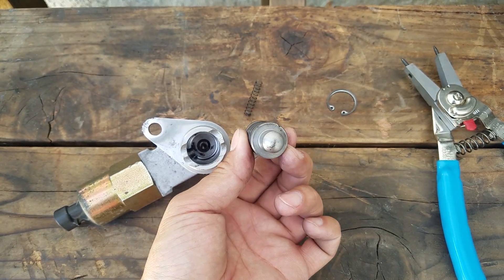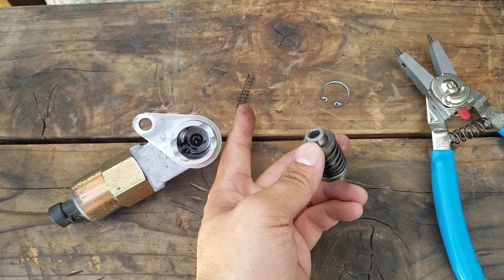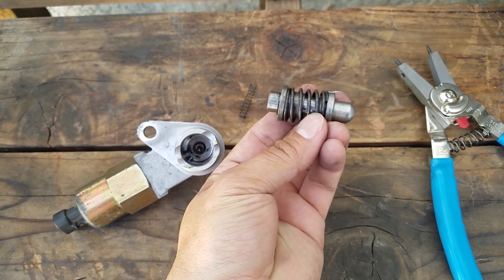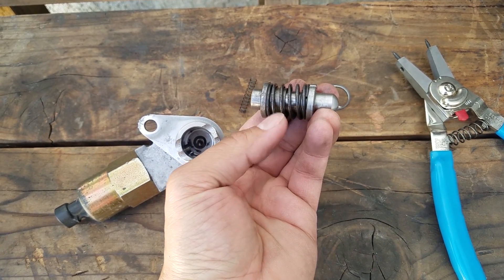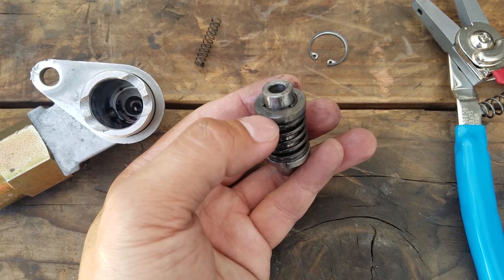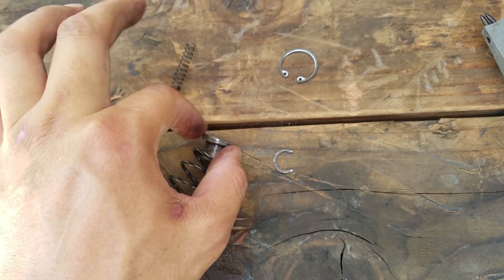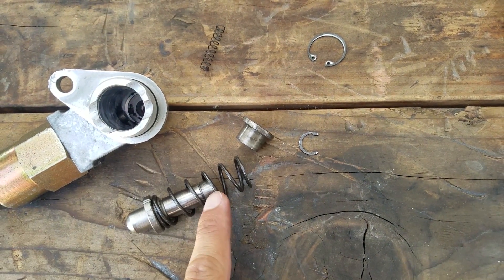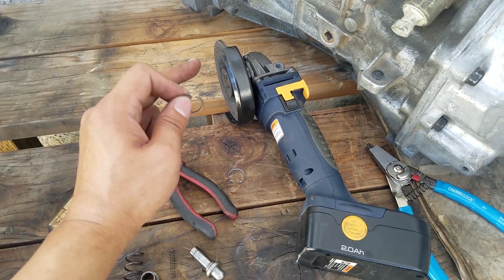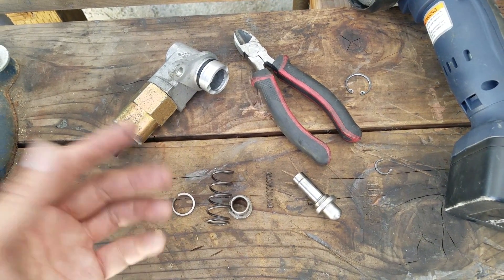I'm going to use the snap ring remover and take off this snap ring right here first. Once the snap ring is removed, I'm able to pull out this piston right here, and below this piston there's actually this spring right here. Make sure to reinstall this spring on the bottom of the piston prior to inserting it back into the reverse lockout. This spring is the one I need to cut, so I'm going to cut one coil off. In order to get access to the spring, there is also a snap ring here, so I got to remove that snap ring and then I should be able to pull it out from this side. The snap ring is removed and this thing just wants to push out, so be careful because it might launch this piece right into your face. I found out this spring was much harder than I thought — I wasn't able to just use a plier to get it off, so I had to use the grinder right here. Here's the piece that I cut off — it's about one coil.